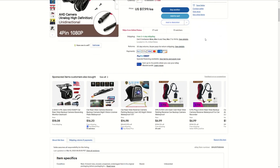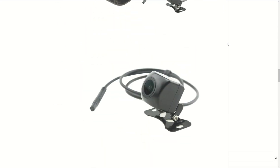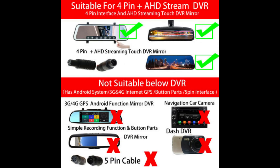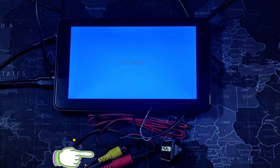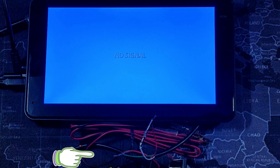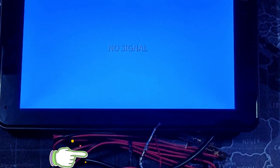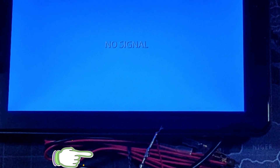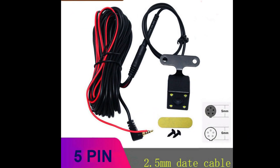Be aware that it has to be a specific type — it seems like it needs to be a four-pin 2.5 millimeter AHD, meaning analog high-definition, streaming camera. I tried splicing in my existing CVBS camera into a 2.5 millimeter pigtail according to the pinout, but it would not take the signal. It switches over to the video input display port but shows no video.